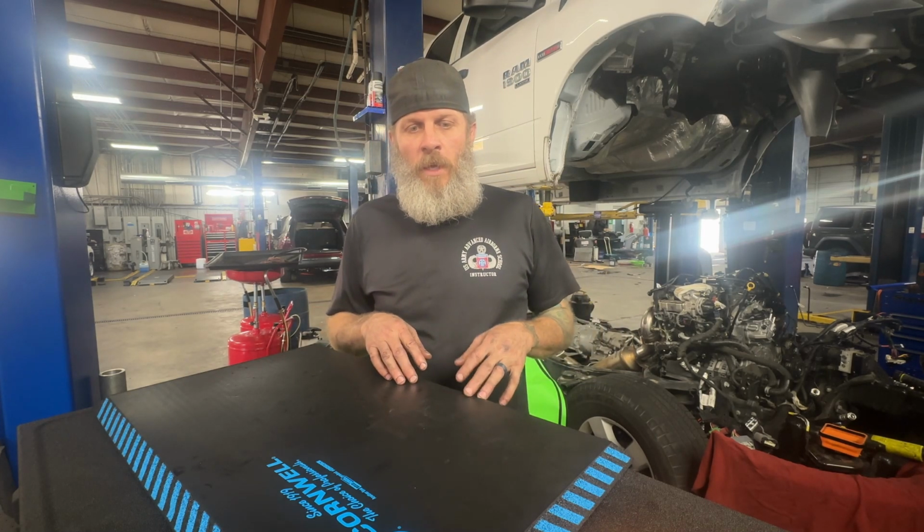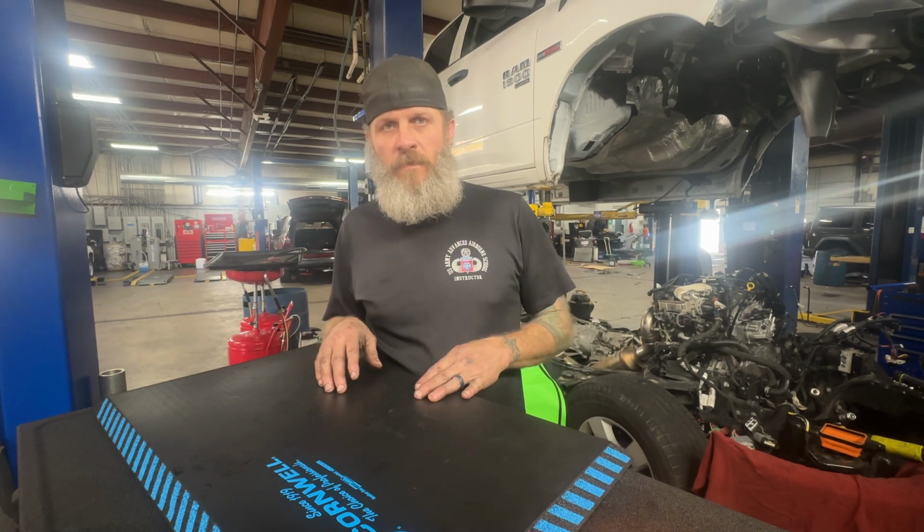Once again, I'm a Chrysler technician, so tailor all of your purchases towards you. Obviously, you're going to need different versions of some of the stuff that I said. Like if you work on Subaru, you're going to have to get the big filter sockets, because reaching up through the exhaust manifold when the exhaust is hot, it's a lot better to do that with an extension for filter sockets.